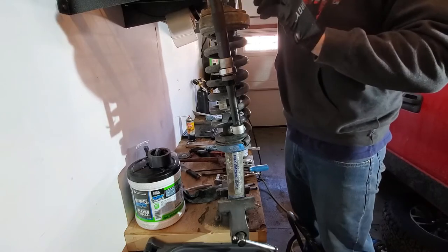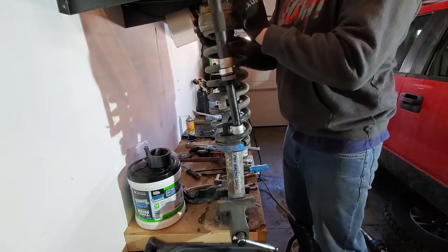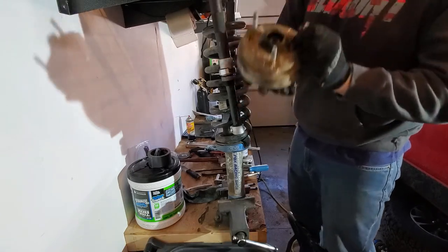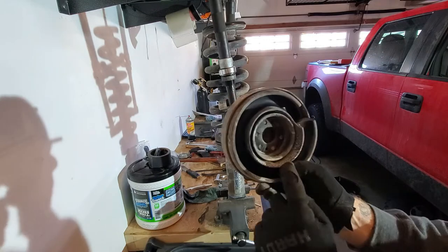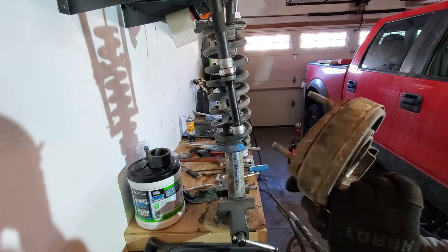Now that's free, your top hat should come off. See all that mud in there — I'm going to get that out. After you get it off, just double check your top hat bushing and make sure it's not cracked or broken. If it is, get a new one.